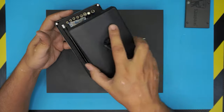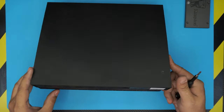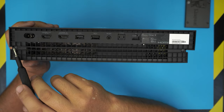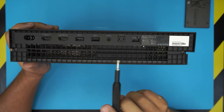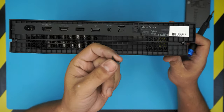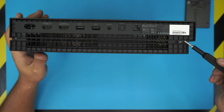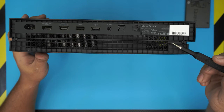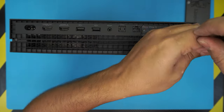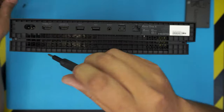We are going to remove two screws at the back of the console — one on this corner and one on the other corner. The one on the corner where the label is: right underneath it there should be a little tiny paper — this is the warranty label. It might be on top so you will not be able to see it. You have to lift up and rip this paper apart. Once you remove it, start unscrewing — they're very tough screws. Remove them; they're all the same size.